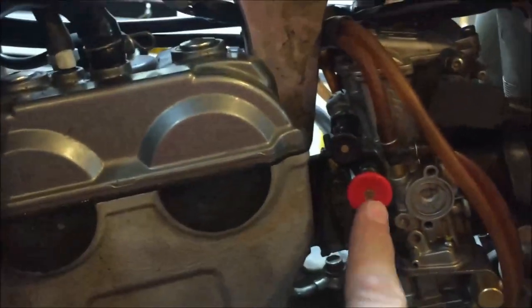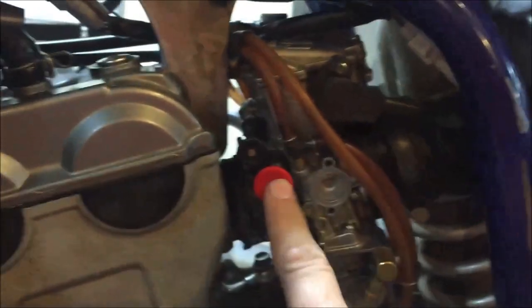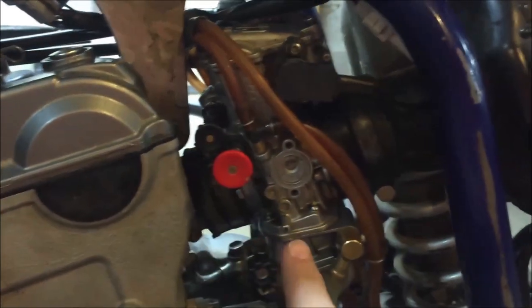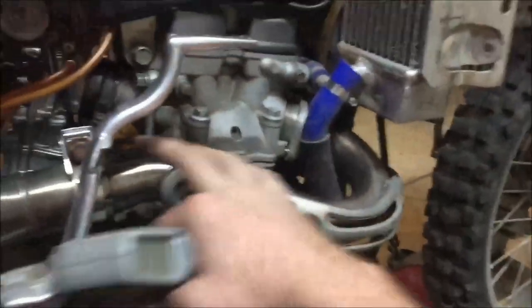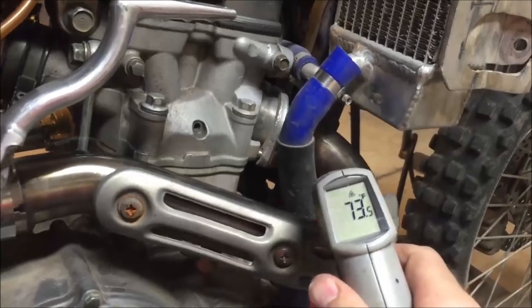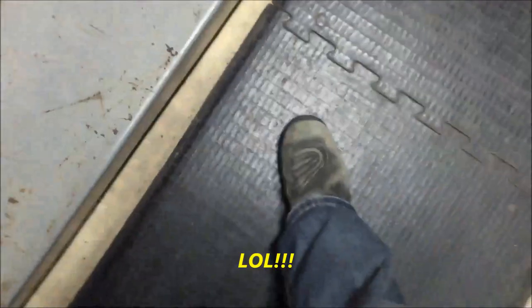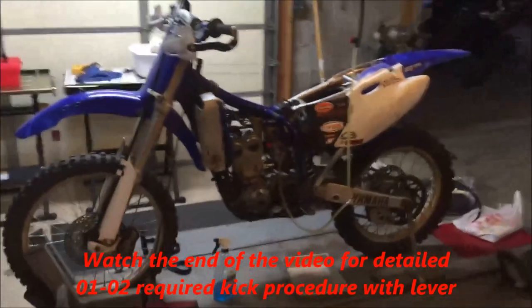You got two little knobs here. This is the choke — the black one, or fuel enrichment would be the proper term. Go ahead and pull that one, leave this one in. There's no need to do them both; if your combination requires both, there's something wrong with the carburetor. So you pull the choke. We'll get to this other one later. I wanted to prove this is a completely cold engine — it's been sitting all day, room temperature. I'm gonna go ahead and kick this thing and it should fire right up. Put on a good boot — this is gonna be a good demonstration of how to start a YZ250F cold.